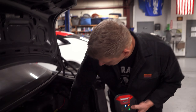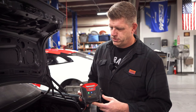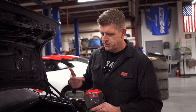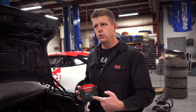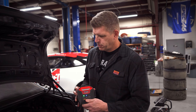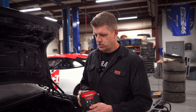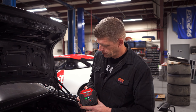Another cool feature — it kind of protects you from yourself. So I'll switch it around and plug it in the right way. Now this is a Digital 200 Plus, and that 200 means it's a two-amp charger — really a trickle charger meant to be a maintainer. If I needed to fully charge a battery of this size, it would take a couple of days with this two-amp charger. We do have a new Digital 400 Plus and a 1200 Plus coming: the 200 Plus is two amp, the 400 is four amp, the 1200 is twelve amp — bigger, higher-amperage chargers. This is really intended for storage, but it gets the job done if you need to charge a battery or bring it back from dead.